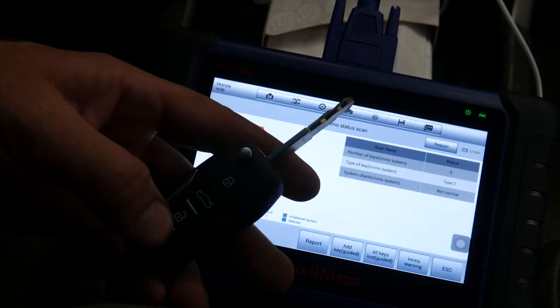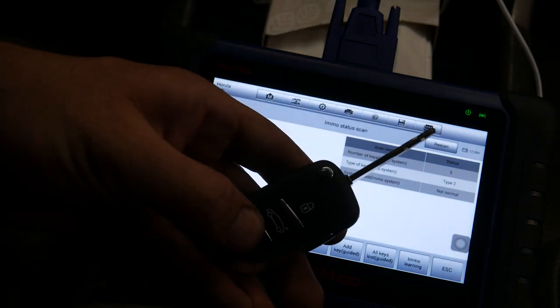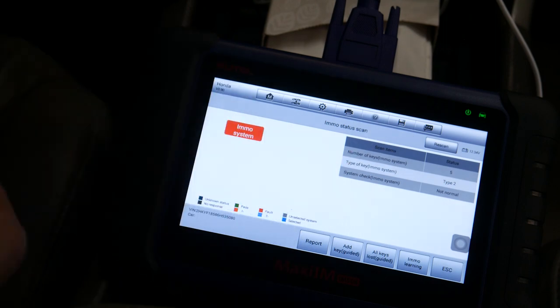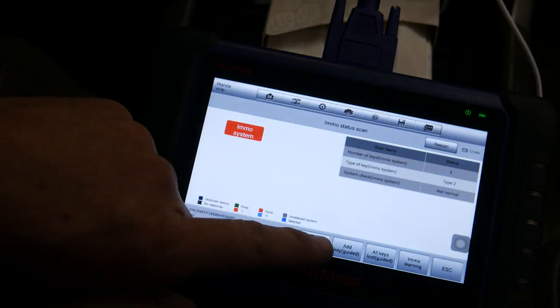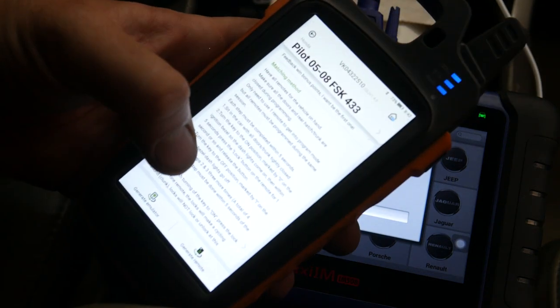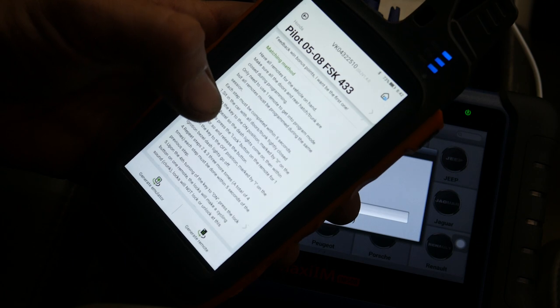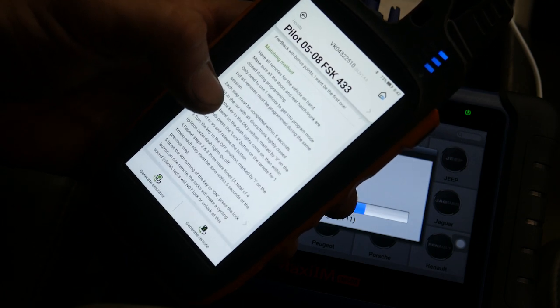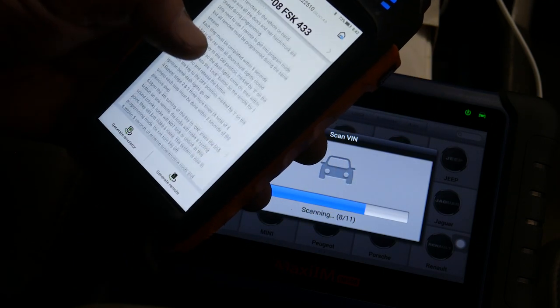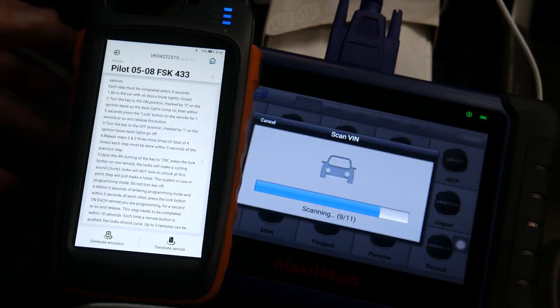Now, I don't know if these remotes have to be programmed separately. They must have to be. Have all remotes for the vehicle on hand. Make sure all the doors and rear hatch are closed during programming. You need one remote to get into programming mode, but all remotes must be programmed during the same period. So I'm guessing it's a manual remote programming process.